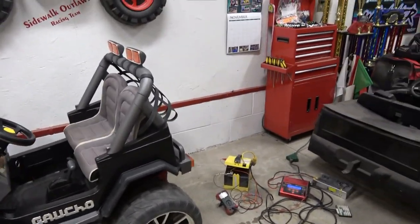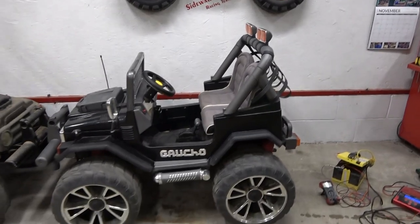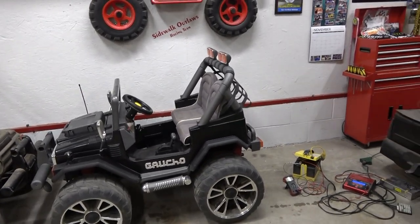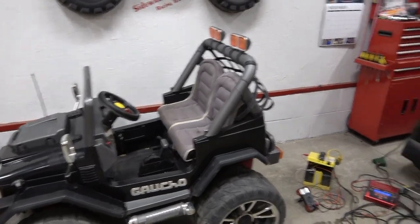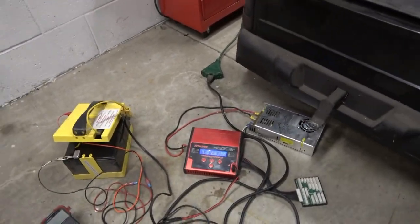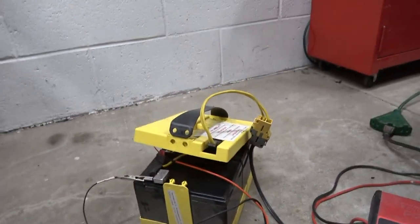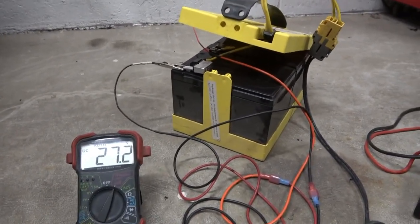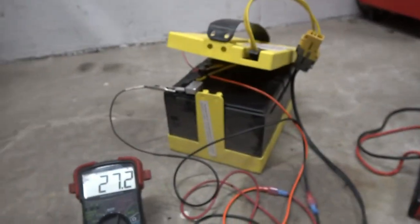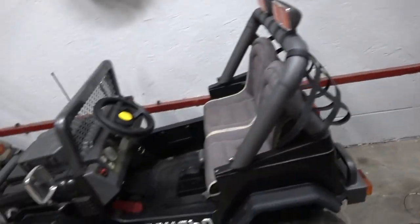It has one pretty good battery and one battery that's completely junk, but it has the handle and the wiring harness. So instead of spending 120 to 150 dollars on a new battery, you can go on Amazon for 50 bucks and get two Mighty Max 12-volt 12Ah batteries, throw them in, and have years of success as long as you charge it correctly. I'm charging it with an RC battery charger and monitoring the volts because the stock charger wasn't charging it — it was saying it was charged.